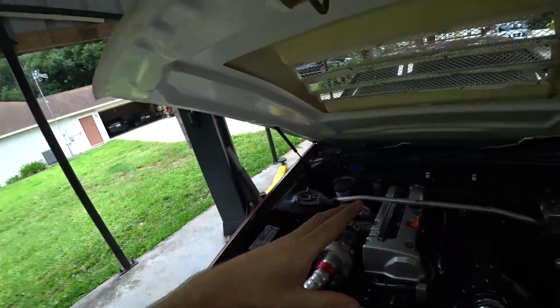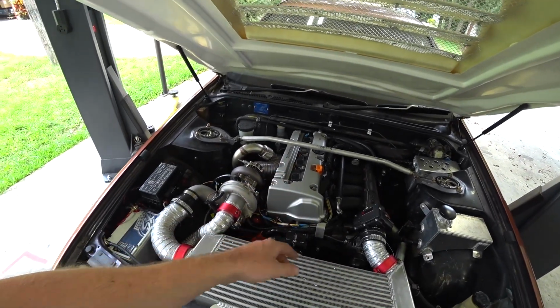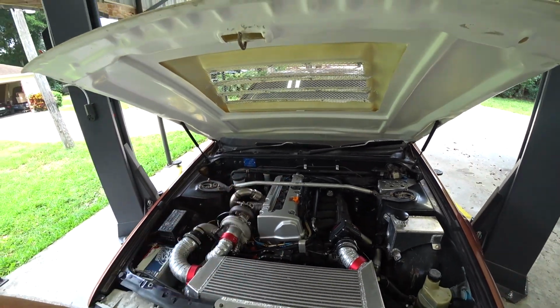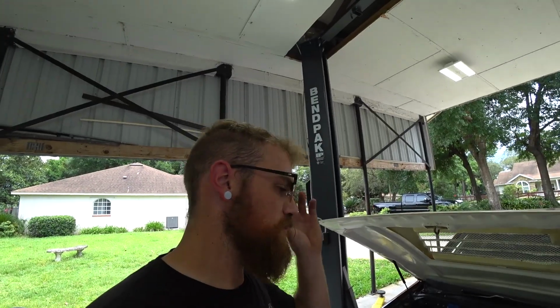So either the cam gear got messed up when I installed it, the solenoid is bad, or something else is wrong. But it seems like the sensor is reading fine. It's just something's going on there, but that isn't our breakup problem because it's wrong all the time and there's no error. So I know I'm jibber jabbering technical details, but we're working through it.